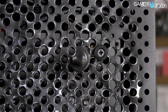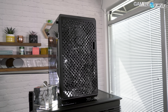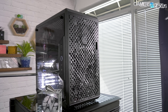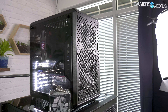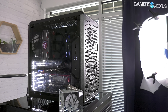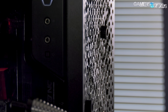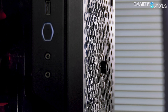To improve this further, we'd also want to drill larger holes in the front top before the CPU fan, as this is where the CPU drafts a lot of its air in the stock negative pressure setup, with the power supply blocking some of the front intake. The same can be said for the holes in the bottom near the video card, although at that point you'd basically have a steel frame with a cheese grater on top. Note that the power supply placement can be switched between front top and front bottom, and that this will inhibit airflow, nullifying that mod in that region.